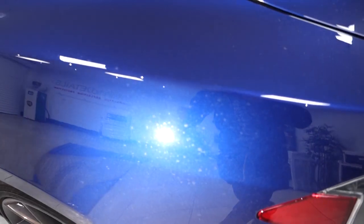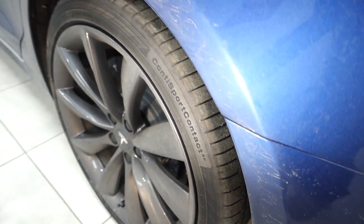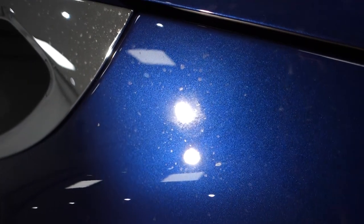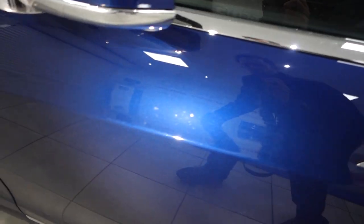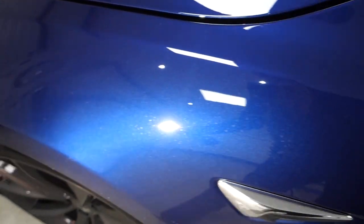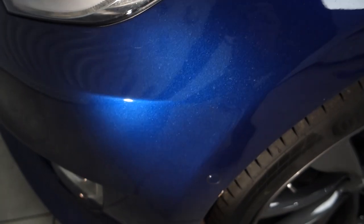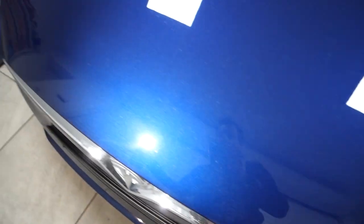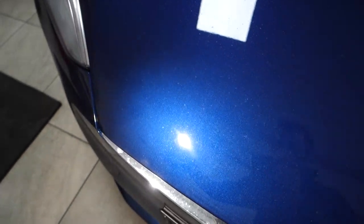The black one was very delicate and soft and hadn't been prepped that well at the factory. This one has just been dropped off so it's dirty, and until it's washed safely and across on the ramp we won't have a true idea of the finish. However, I've already found some areas of denibbed sanding marks around the light clusters — there's the edge of a denibbing area with some light buffing marks around the perimeter. There are also light machine holograms present on the bonnet edge.